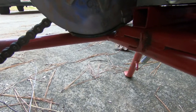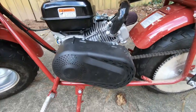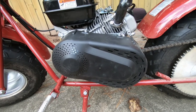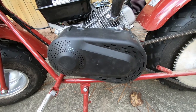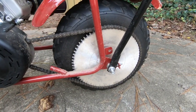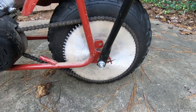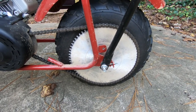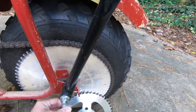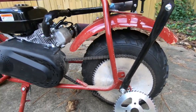I put the new torque converter on — the 30-series from Go Power Sports — and that's worked out really well. I'm not going to take the cover off because it's a bit of a pain the way I have it wedged in there, but it's given me a lot of great low-end power as well as high-end power. Probably the biggest thing for pulling, in addition to the torque converter, is I swapped out the sprocket — this is the 72-tooth sprocket, the largest I could get from Go Power Sports. Here's the stock sprocket; you can see it's quite a bit smaller.